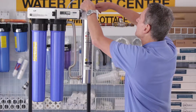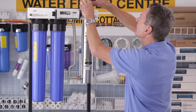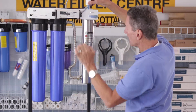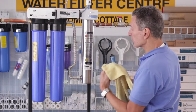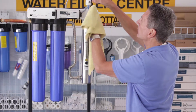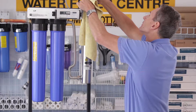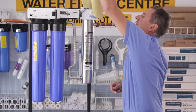There's a little nut on the side of the electrical connection here — you unscrew that and then the top of the electrical connection and the bulb come loose. You need to grab that bulb — I always recommend you handle it with a cloth. You can touch the ceramic ends with your fingers, but it's always better to use a cloth. Then just pull the electrical connection straight off.